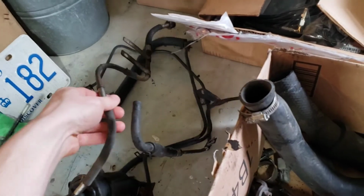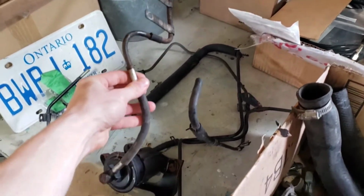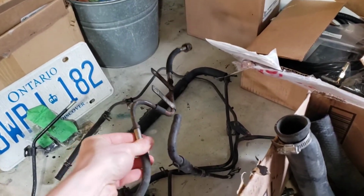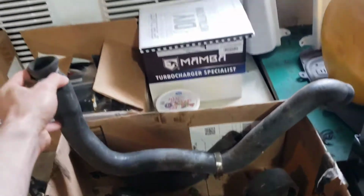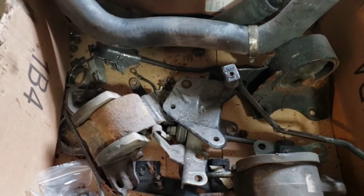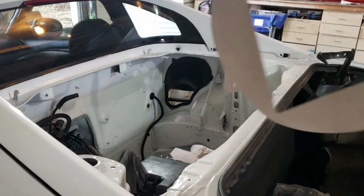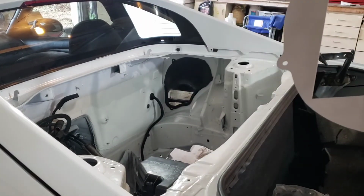This is the hose I'm going to be rebuilding with that 6AN. This is the one that goes from your tank to your fuel filter that always rusts away. It's kind of sketchy. I'm going to be doing an evap delete, so that deletes most of these hoses. That nice MR2 Heaven hose I showed you replaces this one. And I'll probably replace as many mounts as I can, then paint the rest with rust paint because they're getting kind of rusty. First step for the intercooler, I think, is to install this little shroud over top of that black rubber piece in there.